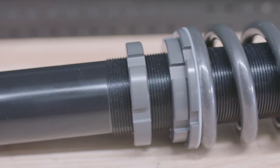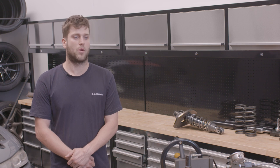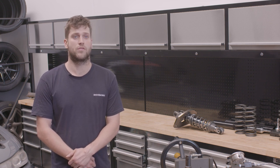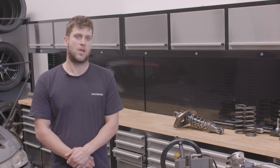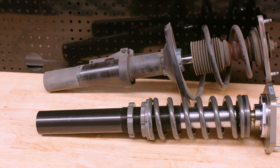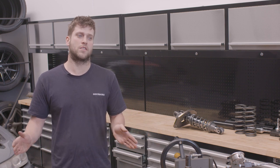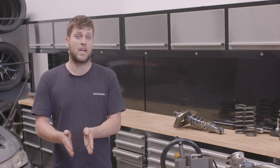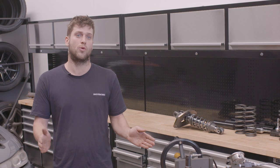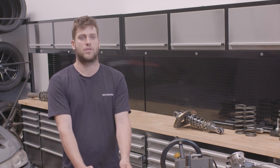A coilover from us on some models will be set to a factory-recommended height, but for most cars — because spring rates and vehicle weights are always changing — we just set them at a rough base height. I usually measure the length of the factory damper, then measure against my damper and adjust based on spring rate versus how much droop I want. Because the spring rate is usually heavier, I'd start with the coilover set 20mm shorter than the factory damper to sit at the factory height, then reduce further to achieve the desired ride height.